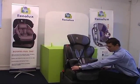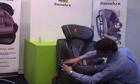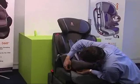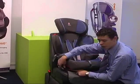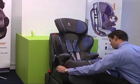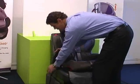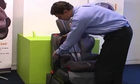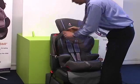section around the front of the seat and underneath, and one of the essential points is to ensure that when we're locating the lap belt section, we get it completely inside of the guider and under that little red lip there. Do the same on both sides. Once we position the lap belt into position, we then click the buckle into position like so. Slide the belt through the tensioner, like so.